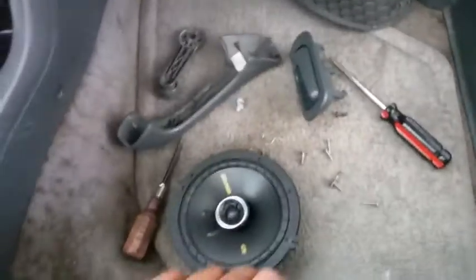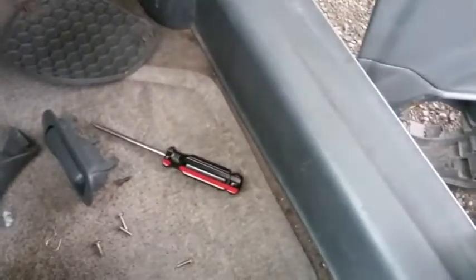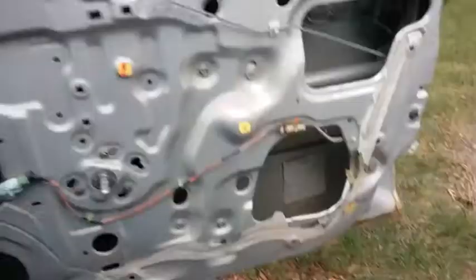Got the door panel off, got all the stuff right here. Look at these — I didn't even notice these were on here. Got some nice aftermarket speakers, these Kickers. Broke a few things but it's all right, probably just JB welded back together. Now I'm gonna take all this stuff off. When you got the whole door panel off, you wanna roll the window down until you can see this bolt right there so you can get an extension to it. After that the window is gonna fall, so you might wanna put some tape on there to hold it up, then take those bolts off.